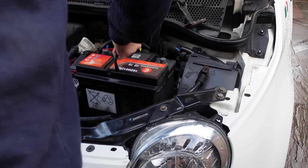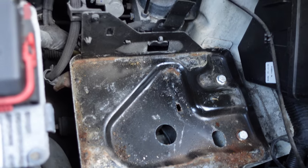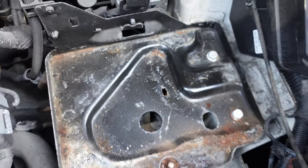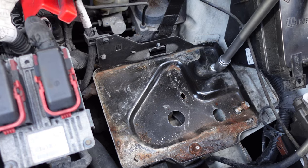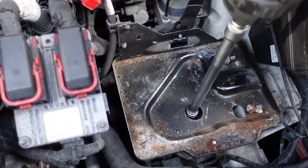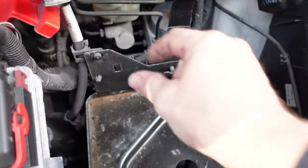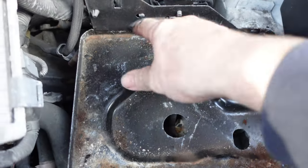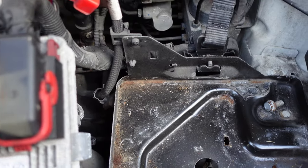Pull up the handle if your battery's got one and lift the battery out — don't forget the battery's heavy. We have this little tray here which has got a pipe in it, so you just lift that off and move it out of the way. Then what we've got is a 13mm bolt there, a 13mm bolt there, and down there is another 13mm bolt — so we've got to get those three bolts out. Get your socket or your wrench. They shouldn't snap — I've never had one of these snap. There's a nut on there which has probably fallen in, but it's just sitting on the top so we can just pull that off. Then we need to release those cables on there and there because they're in the way — they're securing the cables — so just get a tool and prise them out. We'll do that and then take the tray out.